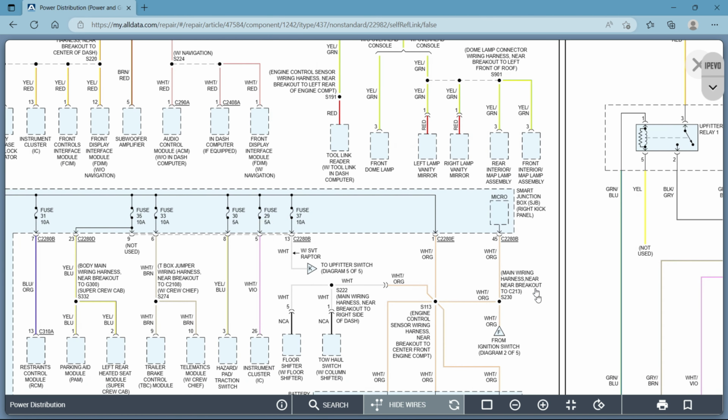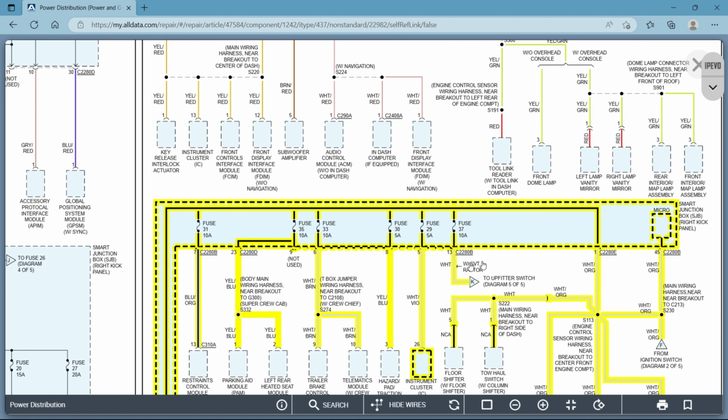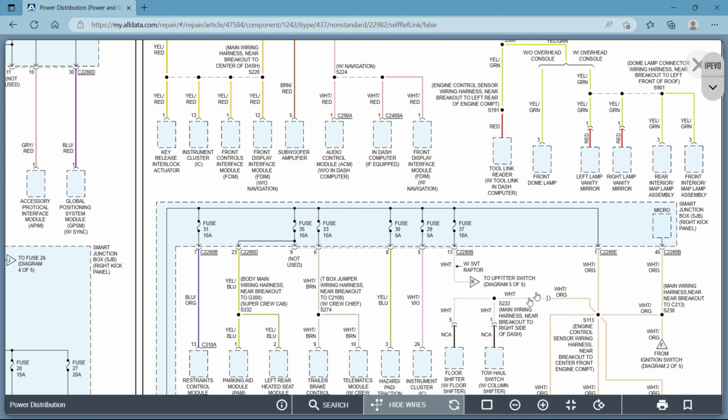See if we can find one. There's a good example. There's your connector numbers again, as I've used this example already, but you just pay attention, and this looks like a train wreck of information all in one spot, and it kind of really is, but just spitballing off the top of my head, what I'm trying to get you guys comfortable with is what you're reading. Connector number, wire color, spliced, where the splice is, 230, okay? The dashed line, meaning that it's not complete. The pinout number, again, another connector number.